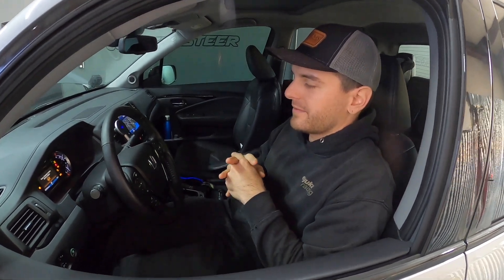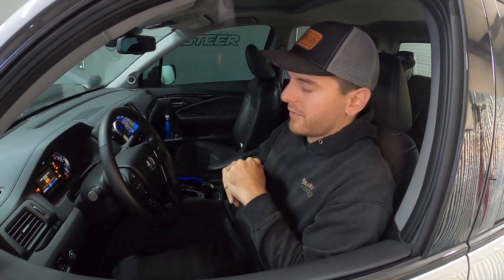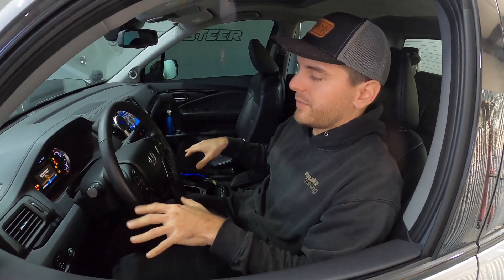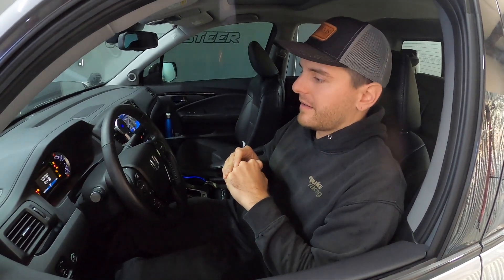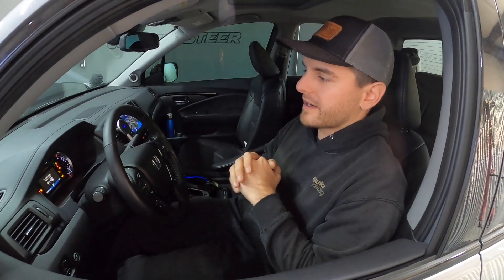It will try to apply the brakes — you'll feel an ABS pulse. If you don't have it in sand mode, it will want to downshift when you go to do a full throttle pull. Once you have all three of those areas situated, you have to get past 2,500 RPMs in first gear, lightly lift off the gas pedal, and it will shift to second. Then it appears it doesn't want to shift to third until you go past 4,000 RPMs in second.